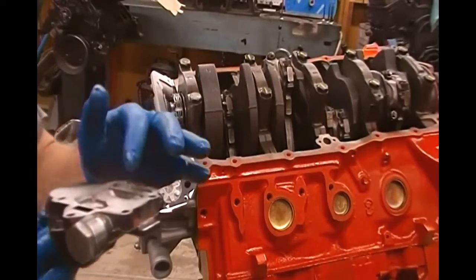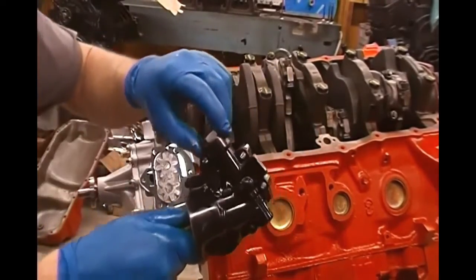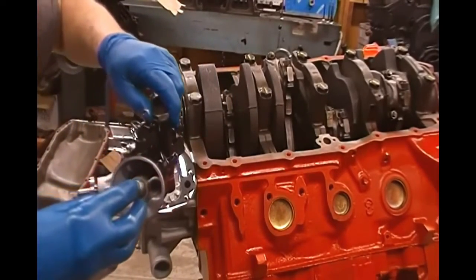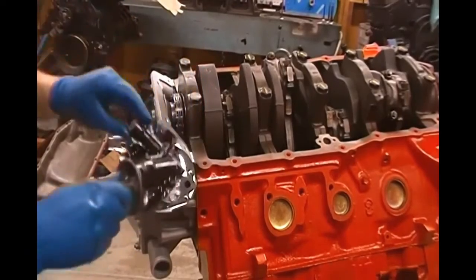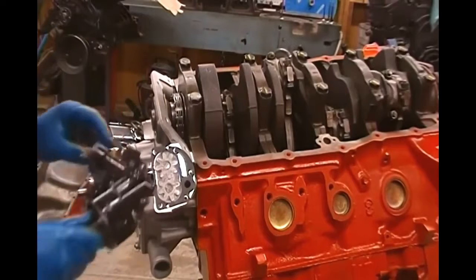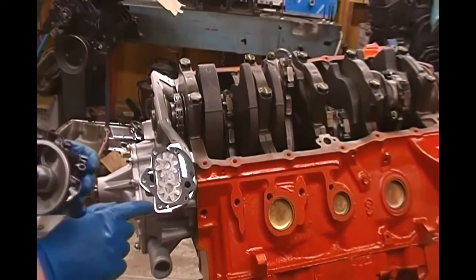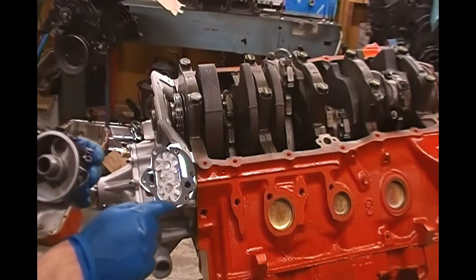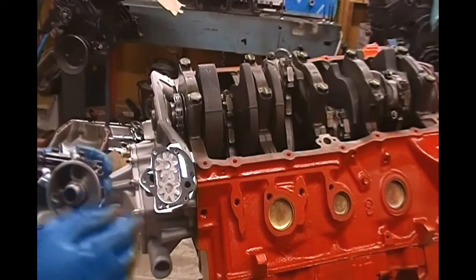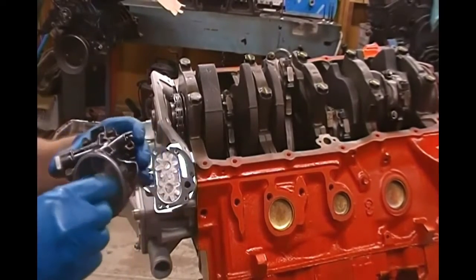And this is not only your pressure relief valve here, but it is also your cover for your oil pump gears, and it's your oil filter housing here. So that goes on just like that. You want to put the housing bolts on there, and then you torque them on, and that's the next step. The thing about putting Vaseline on here, if you look at this, holds the gasket down real good, keeps it in place. So we got our gears in, we got it packed in with Vaseline, you got your cover.